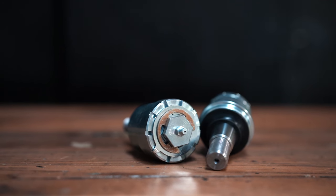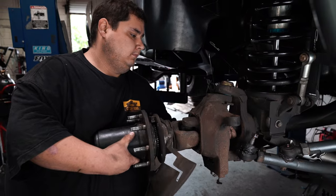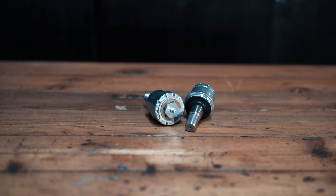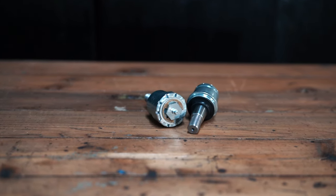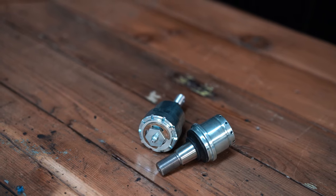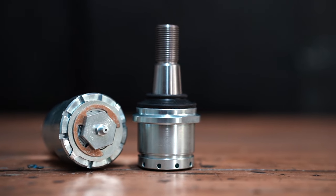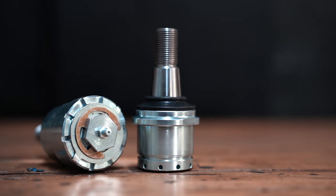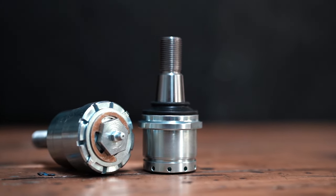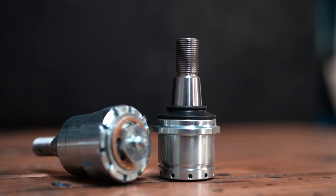Keep in mind that rebuilding any Dodge Ram 2500/3500 ball joint still requires full disassembly — you have to pull your brakes off, remove your axle shafts, and pull the knuckle off the truck. It's basically the same procedure as installing the joints, but you're not going through the hassle of pressing them in and out or stretching your axle. Dynatrack's fit and finish is excellent. They are made right here in Huntington Beach, California — an extremely solid company, well known in the Jeep market for their replacement axles. A solid number two on our list.